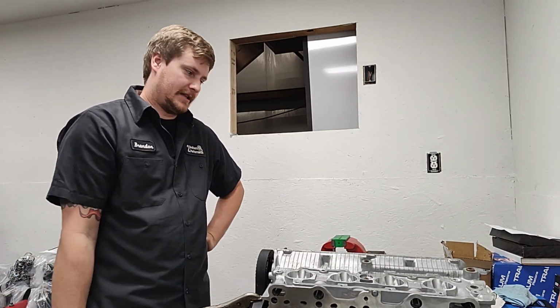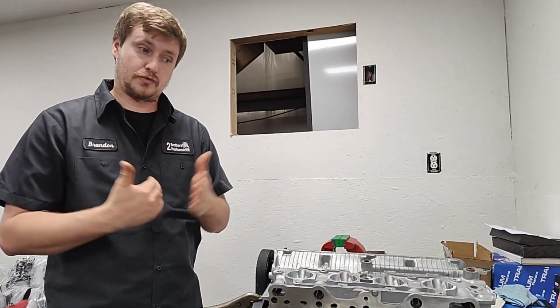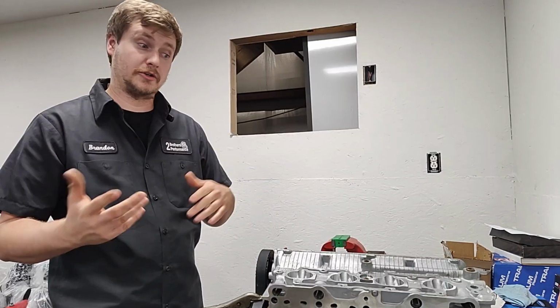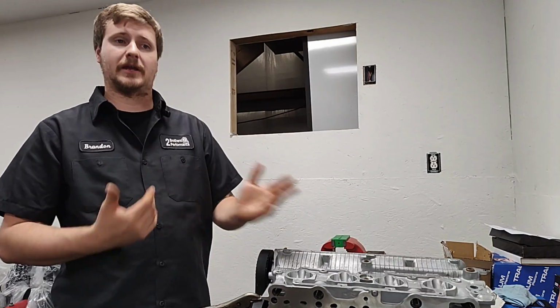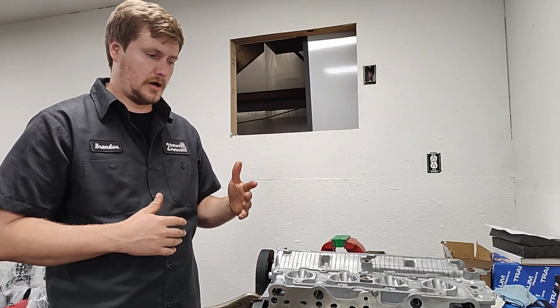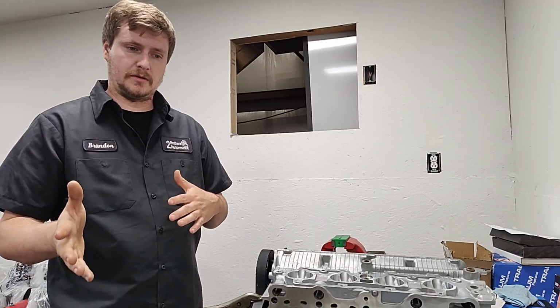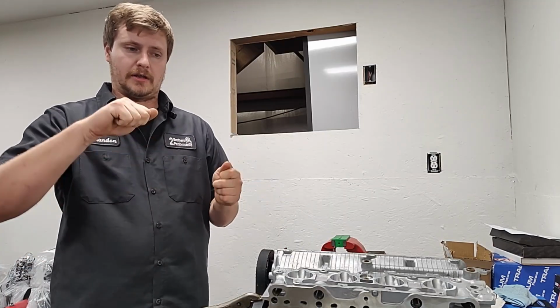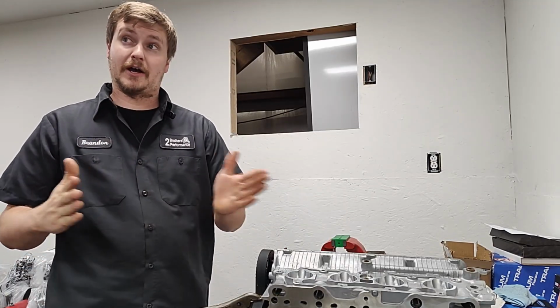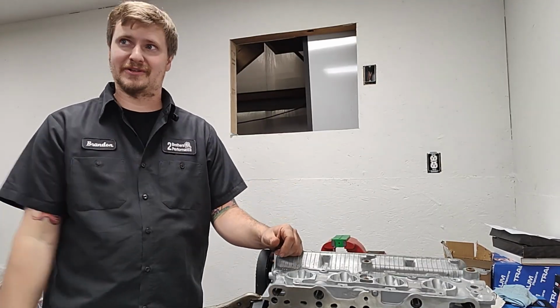And I have never once ever seen a true drop-in cam. And yes, you might be able to drop it in at 0 and it'll make power, but degreeing it matters. When we first started messing around with cam degree, we knew what it was supposed to be, and then we had our chart. And so we started moving the degrees on the dyno. We were picking up 50 horsepower on the CRX per degree we were moving on the exhaust.